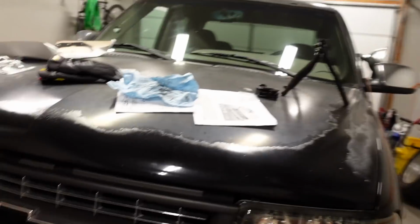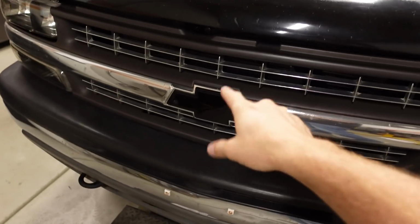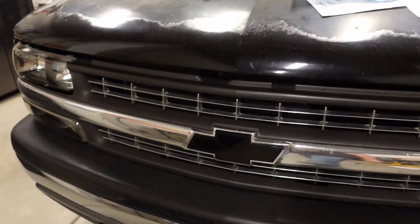So anyway, this is pretty much a complete rebuild, and I do need to get this in the truck, but there are a few more tweaks that I need to make before we actually get this thing out on the road and drive it. Mainly the transmission cooler. So far, the Ugly Truck's been using the stock trans cooler behind the intercooler, and there's one in the radiator. And the trans temps have been right around 195, 198, so it's on the warm side, but I'm replacing all that.